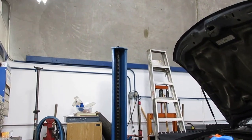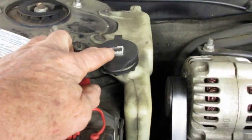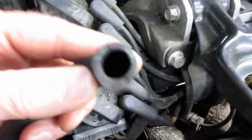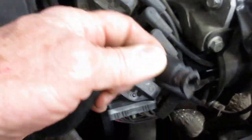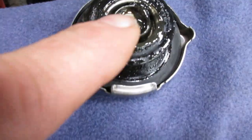I always take the radiator cap off because I don't trust just the coolant reservoir to see how much coolant is in the whole system. What I found is I looked inside and it looked real dark. It has a hose that comes off and runs along to the radiator — it's your overflow — and it's all soggy. So when I removed the cap off the radiator, it's got a bunch of engine oil on it.